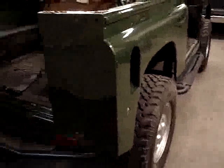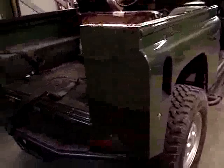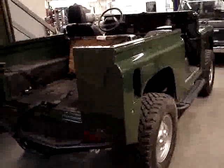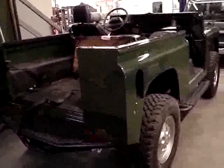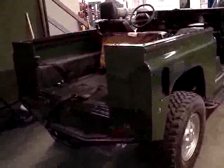The paint is flawless — very clean, no contamination. Next on our list, there's been a request to paint the frame, so we're going to paint it as best we can. Typically you'd want to sandblast a frame, but this project doesn't really warrant it. We're going to do some scuffing of the frame and paint it with a good frame paint, probably SEM Rust Shield.